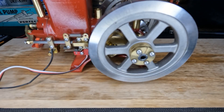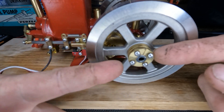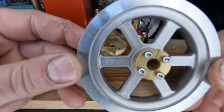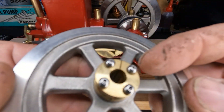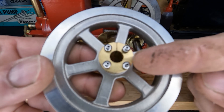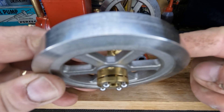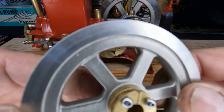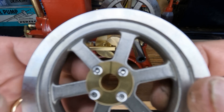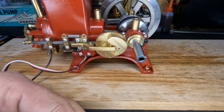I've got you pulled in closer. We've got this loose - this is a collar and they're tapered. When you tighten down these screws, it pushes in on this wedge and expands this part of the collar in and this part out, and that holds onto the crankshaft. Very nice, very easy to remove as long as somebody hasn't already rounded out the screws. These things are fantastic.